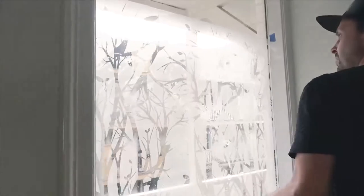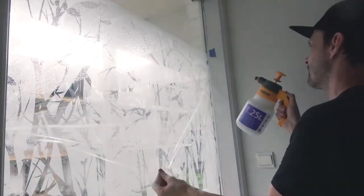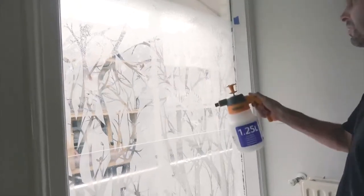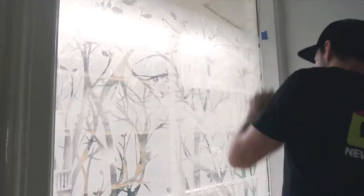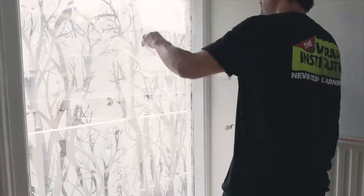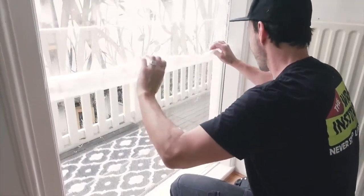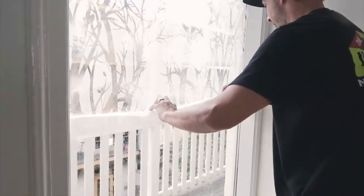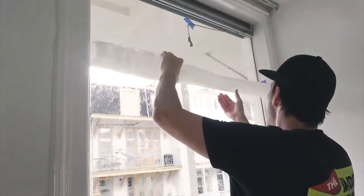Remove the liner just partially, spray the adhesive with a slip solution, then remove the liner exactly halfway, being sure to spray from top to bottom. Once the adhesive is evenly moisturized, roll the liner back onto the adhesive and lay it flat. Then repeat the exact same steps for the bottom half — remove the liner exactly halfway, thoroughly spray the adhesive with a slip solution using the pressurized sprayer, then lay the liner back onto the adhesive. Make sure it's nice and even, then carefully roll the film up. Be sure not to crease it at any point, and always work from the bottom towards the top. Once completely rolled up, remove it from the window and keep it in your hand.